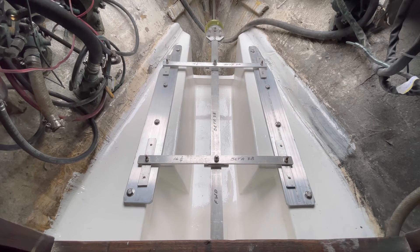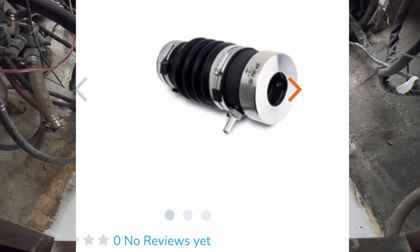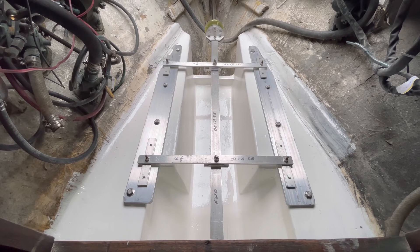We have the shaft log loosely in place — you can go ahead and bolt that to make sure it doesn't move, though it will be the last thing permanently installed. We have the drive shaft with the drive shaft coupler precisely 23 inches from the aft part of the engine bay. We've also made sure the propeller can be installed. When we return to this point, the engine will be installed and we'll slide the drive shaft through the shaft seal — we must not forget to install the shaft seal before permanently bedding and epoxying the shaft log to the boat.